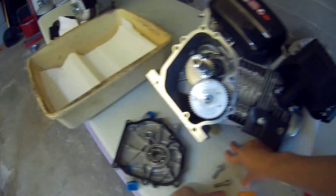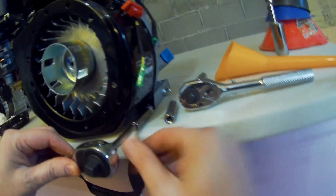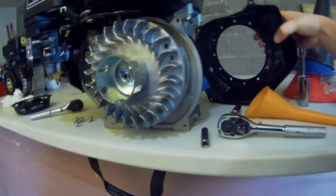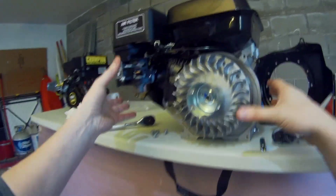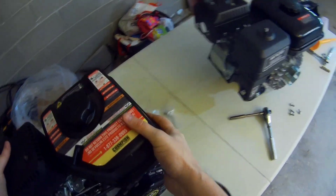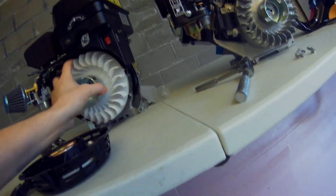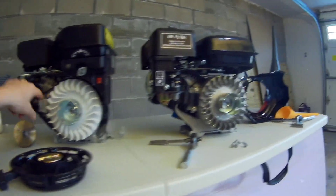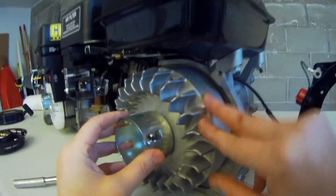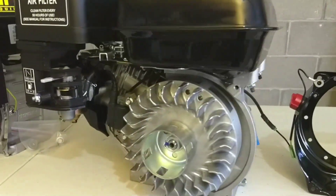I'd love to throw this on the dyno to do a comparison. Inside the engine, I'm going to flip it around and take a look at that flywheel. Let's take a look quickly at the internals of a race engine versus something that may cost roughly the same — one of your more generic Honda clones. Plastic parts, screwed-on magnet for your coil, flywheel versus what appears to be machined in. This is actually a really nice flywheel. This is where, I'm pretty confident, your time savings is coming in.